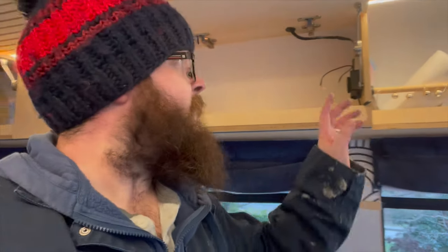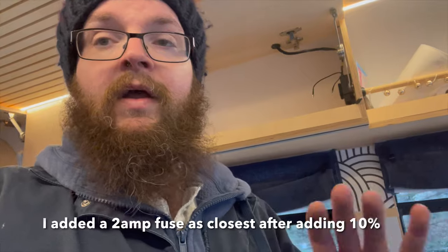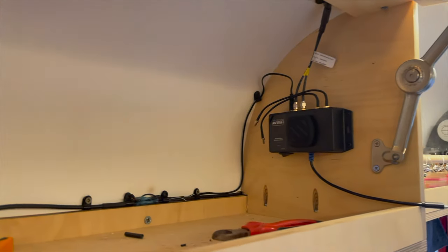The docking station is installed — I popped it up here because it'll be accessible. I'm going to put some cable clips in in a minute. You need to hook it up to a 12V supply — this only pulls 0.4 amps to run. I already have a cable running along here which I've got fused for the fan at the front, and that only pulls 0.4 amps as well. The cable is more than adequate for both — I ran a 2.5mm cable along there earlier in the build. I can splice into that, make sure it's fused no higher than one amp for the combined load, and we'll be good to go.